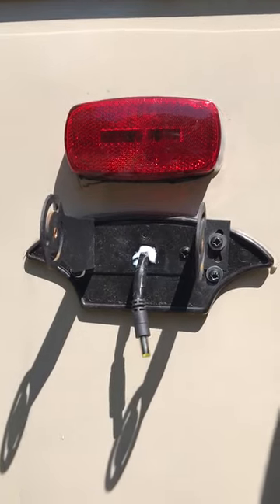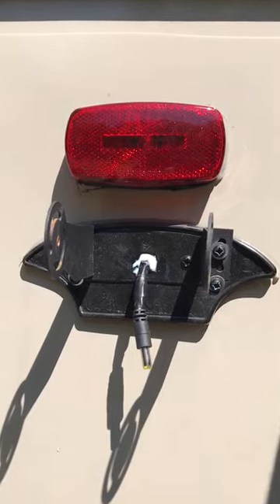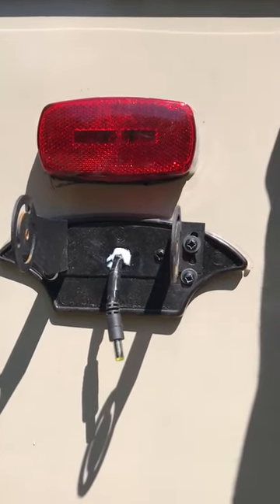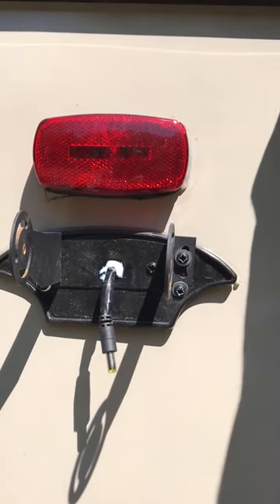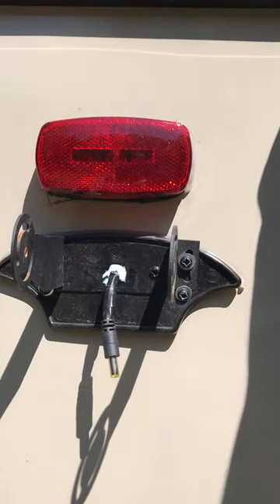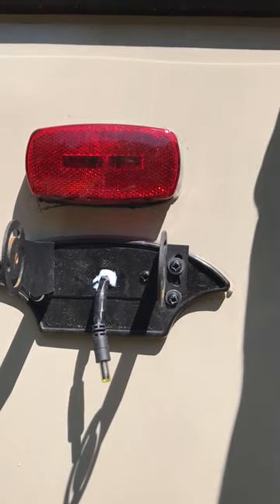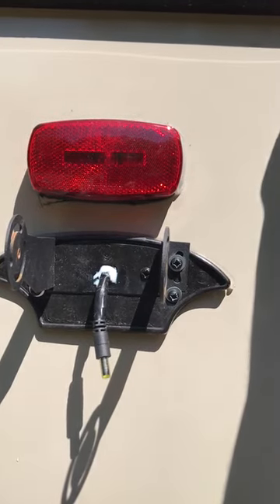Notch in the bottom of your running light, bring your wire down — that would be the 12-volt supply to the camera. You want to hook it up to a running light so that the camera only comes on when the lights are on. Whenever you pull a camper you want the running lights on anyway, and this way your camera is not always on.